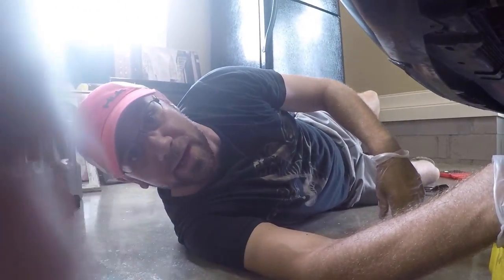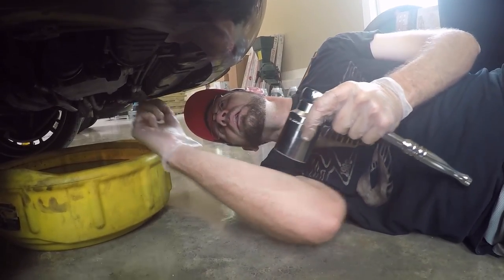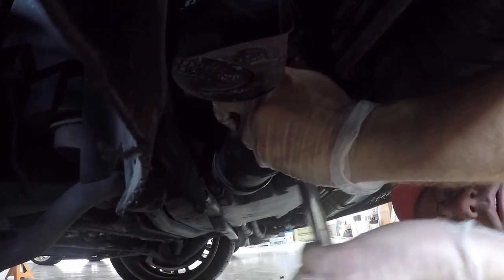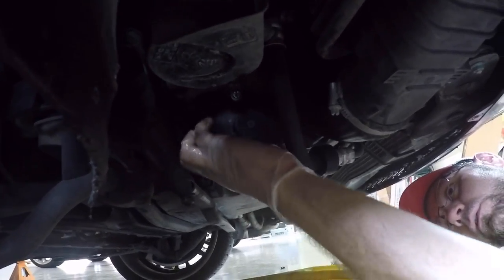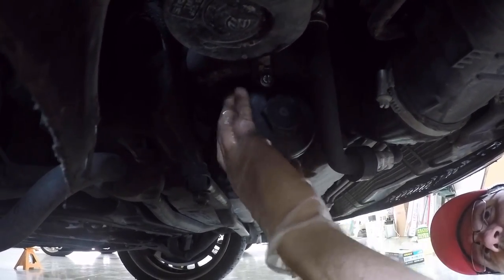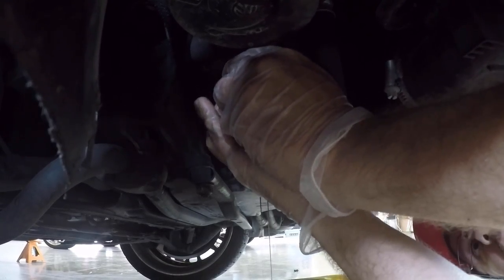I've left the t-shirt so far away and now I'm all dirty. The final step is to use this behemoth — which is a 36mm socket — on the housing for the oil filter. I'm going to put this somehow here, there we go, and start loosening it up. The thing I don't want is for the whole casing to fall into this oil pan and get me soaked. And of course, more oil — it hits this bolt in the back, which is just freaking great.